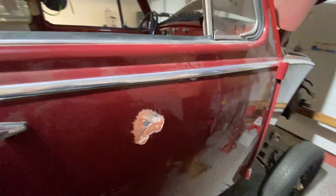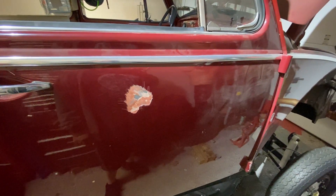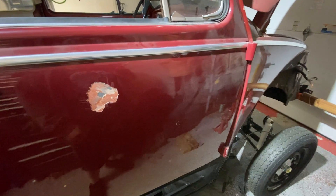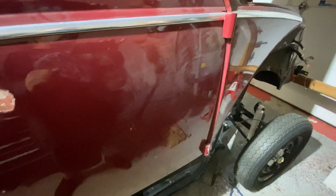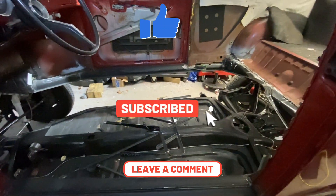Of course, once you add weight to the door it's going to get a little worse — you're probably going to have to shim it. What I mean by weight: you're going to have to add hardware. These already have the glass in them, so be mindful of that. If you don't have any glass or if it's really light, it's going to be different once you put the weight on — it's going to bow a little bit, so you're going to have to shim it. Door panels, hardware, glass, and deadening material all add weight, so your doors will sag and you'll probably have to adjust them a little bit again, but not too much. Anyway, this concludes the video — heater channels are in. They're not fully installed yet, I still have to weld the rest in, but they're installed. Please like, subscribe, and comment. Thank you for watching.